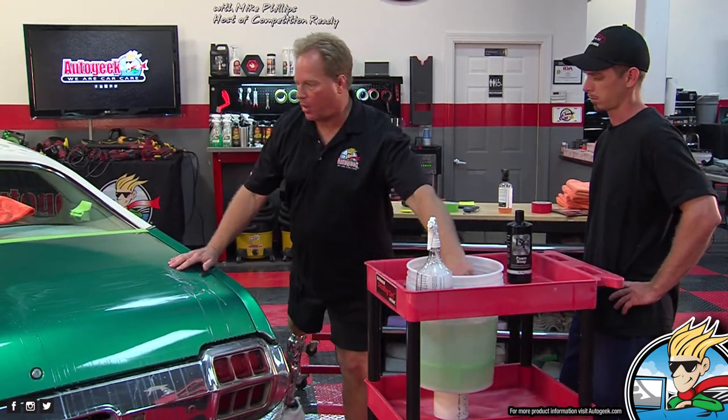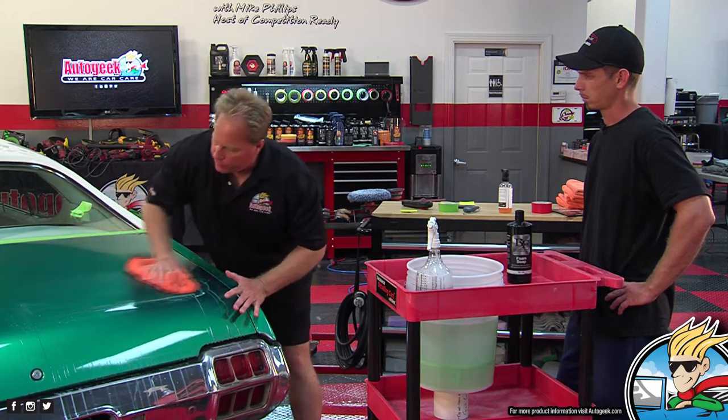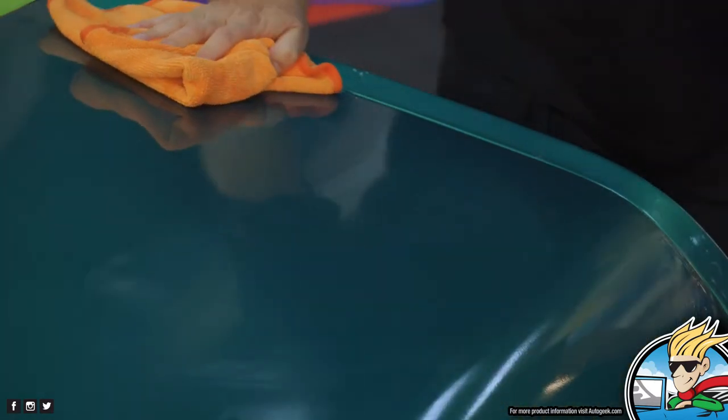Counting your strokes, okay? You guys can figure out how you want to, but I teach counting strokes when you buff, and I teach counting strokes when you sand. It makes you more effective in time management. Well, it's also good material removal management. Yeah, no, yeah.